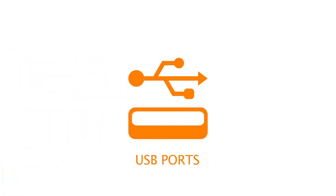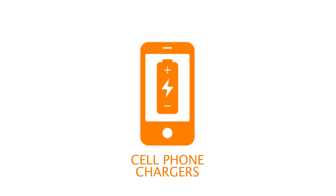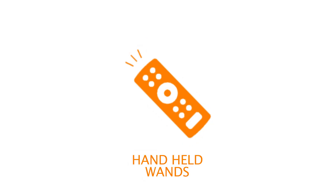There are certain features within the furniture that can cause a constant drain: USB ports, LED lights, lit cup holders, cell phone chargers, and handheld wands that are illuminated. If the battery isn't lasting months between recharges, in the vast majority of cases it's dealing with one of those features built into the furniture.